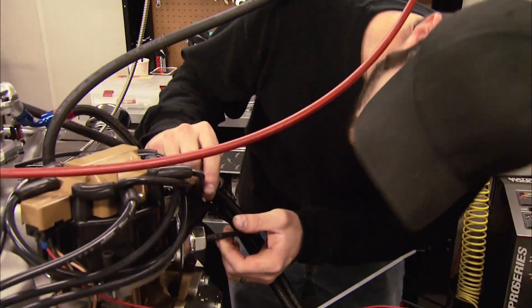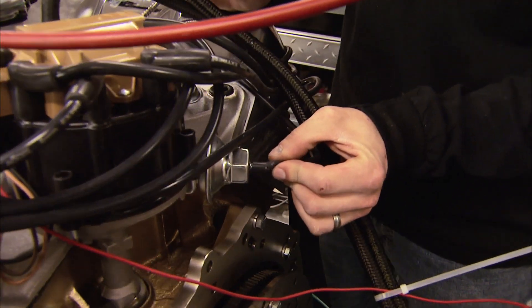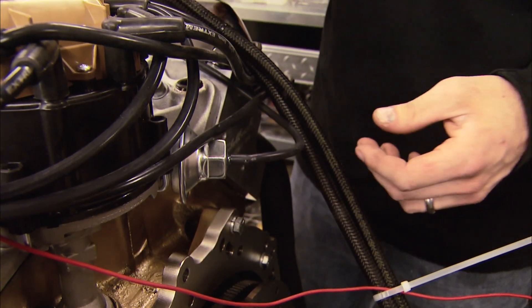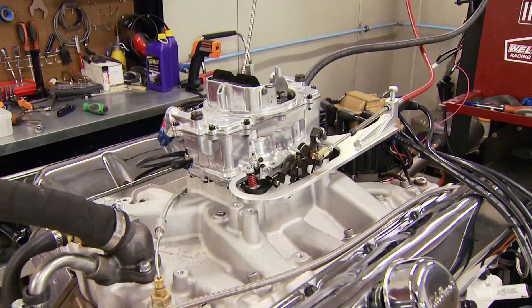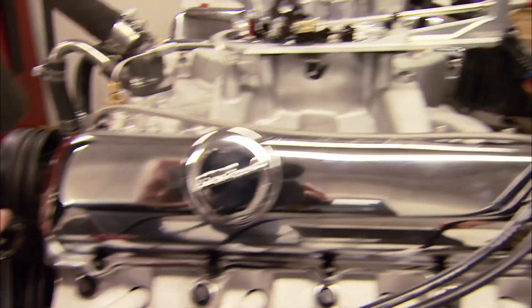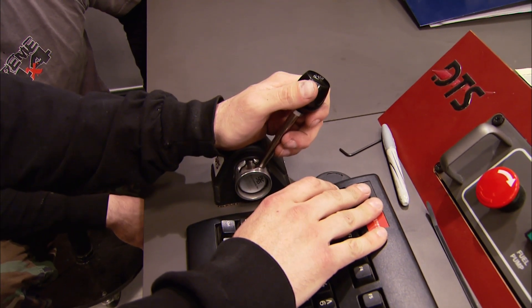Something isn't right — we found a vacuum line with a small hole in it right at the opening of the canister, so it's not pulling full vacuum on the distributor for the advance. We cut it shorter to fix it. After advancing the timing, we're making 500 foot-pounds of torque, but the power's still not there at about 330. When you're sick, you call the doc — and here's Mondello's diagnosis.